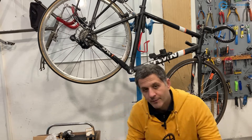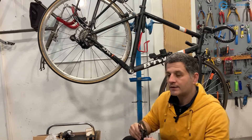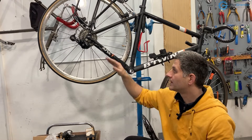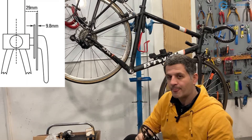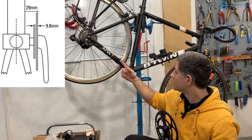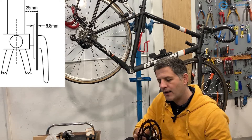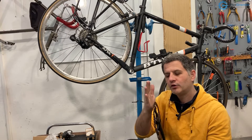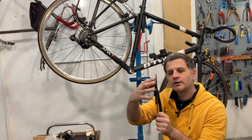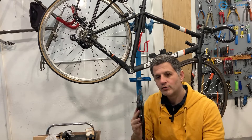What are the limits? First, if I put an axle that is too short, I might have the cranks hitting the chainstays — or hitting them when pedaling under load with some frame flex. I might also have the inner chain ring scratching against the chainstay. And I might have problems with the front derailleur not being able to move close enough to the frame to shift to the smallest sprocket. That is the limit of how close to the frame I can go.